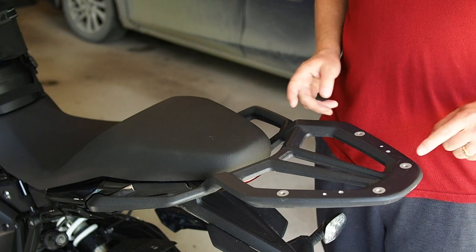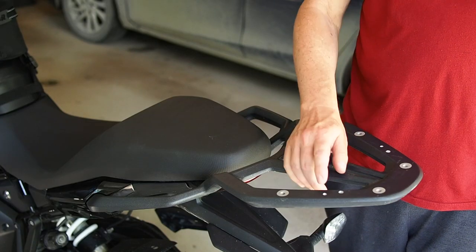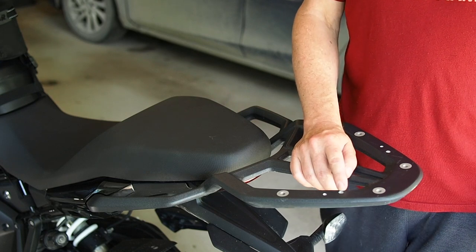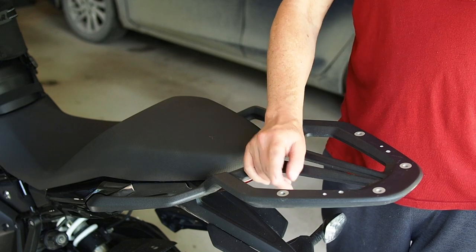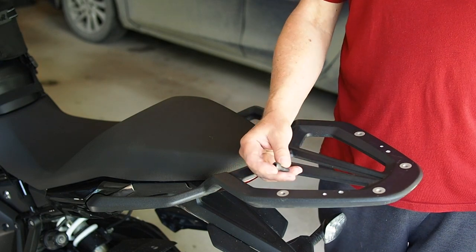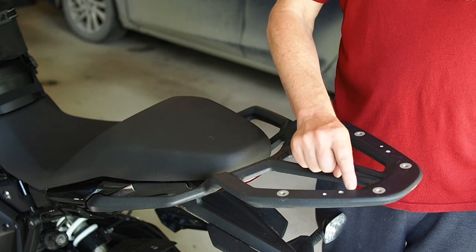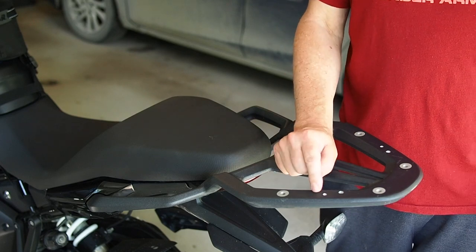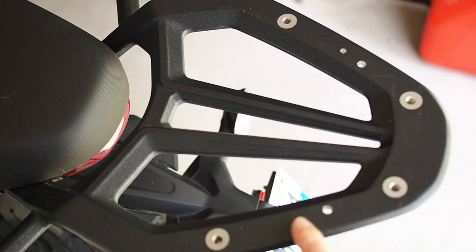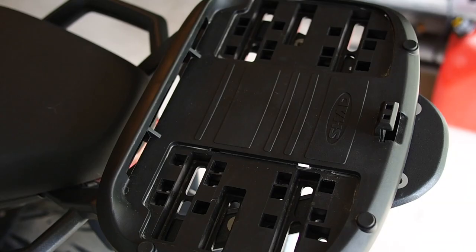I used a half-decent battery drill. I'm going to include a picture with measurements so you can use that in your own install. I originally wanted to thread these bolts in, but I didn't have a tap and die. The Canadian Tire tap set only goes up to M7, not M8, so I couldn't duplicate the threading. And you can't even buy an M7 bolt like that, so you'd be down to a six — a pretty small fastener. That's why I ended up just drilling and reaming the hole big enough to fit one of the bolts that came with the Shad box.